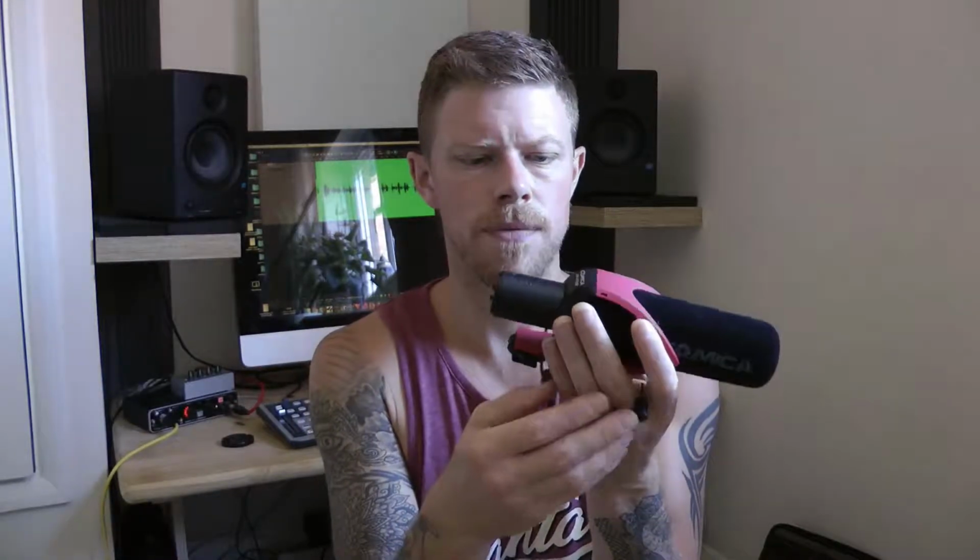The other thing, as it's described as a pro mic, I would have loved to have seen, and this is a bit of a bug from someone that comes more from an audio background than a video background, is some sort of metering, no matter how crude, even if it's one clip LED at the very least, just to give you an idea that what you're videoing at source isn't going to be clipping, and you're not going to be massively disappointed when you get home and you've got useless audio.